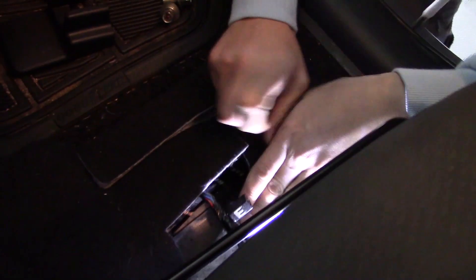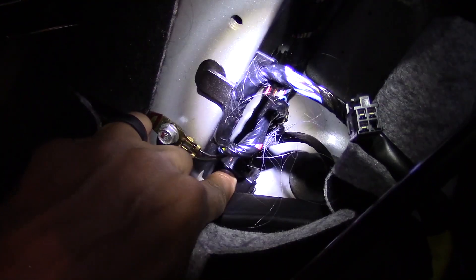You may have to do a little cleanup under your seat — some random stuff gets under there. But now that you have all four 14 millimeter bolts removed, you can shift the seat back as you see in this clip, and then you have better access to the O2 sensor plug.